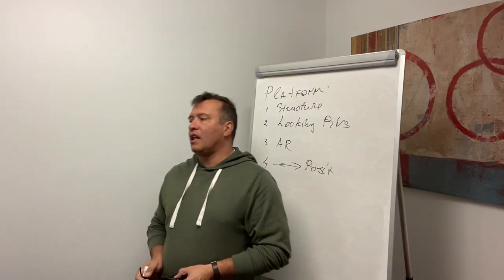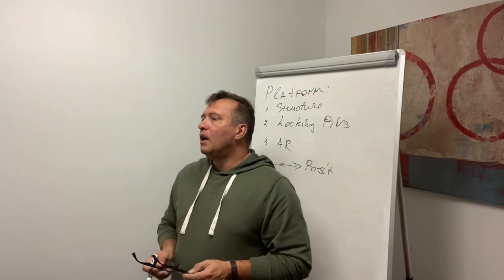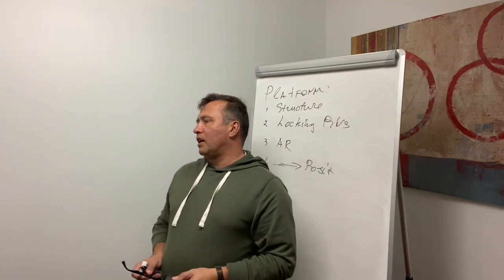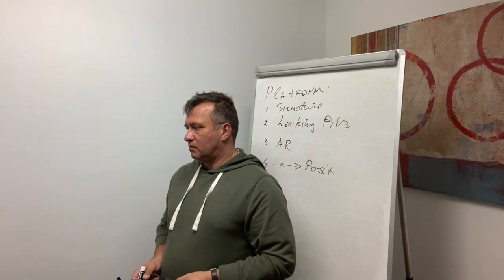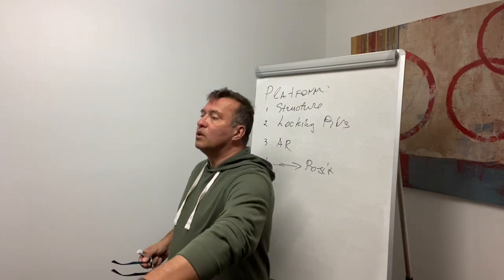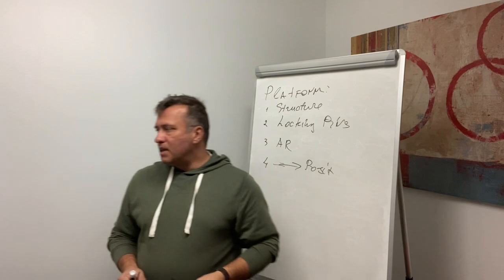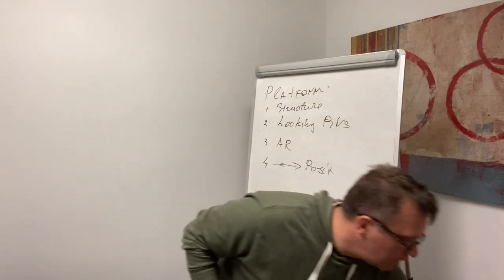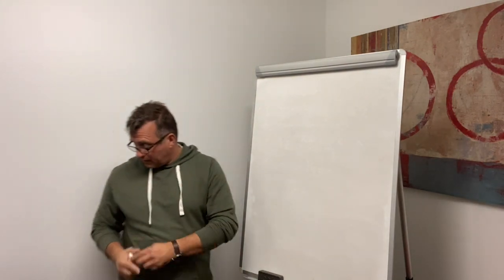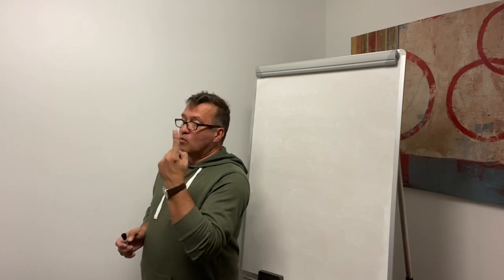Okay guys, the same as in your car. You just got into the car, you put the key in, you didn't do anything on the key, you're trying to turn on your headlights. Are they gonna work? Hopefully. No. Okay, why? Because you need to turn ignition on, as we say, or put it in accessory. Let me tell a few words about key positions on the lock on your truck. There is one more position for the key than in your car.